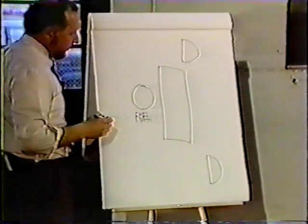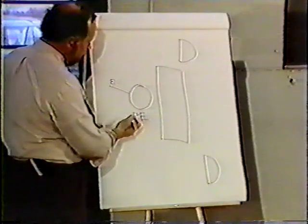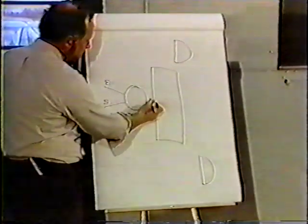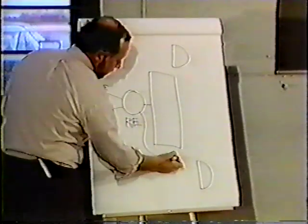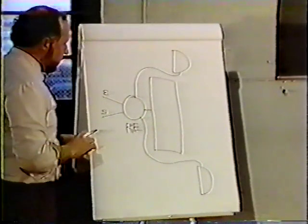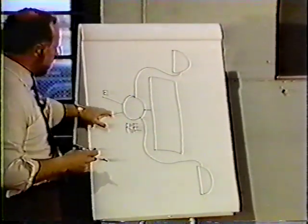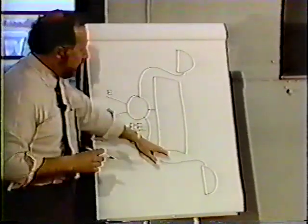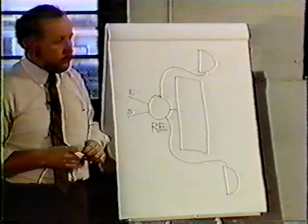Now, this was a fairly simple system. It had an emergency line, which we now call the supply line, and it also had the service line, came from the foot valve. It got its supply of air from the tank, and it delivered the pressure to those service chambers. So when you applied the foot pedal, you sent air in the service chamber, in the service line, it activated the relay portion of the relay emergency valve, applying the chambers, applying the brakes on the trailer axle.